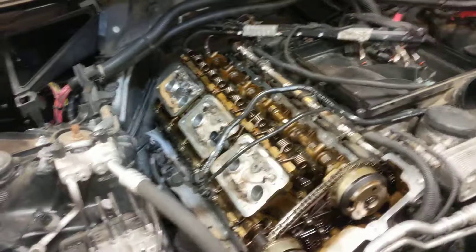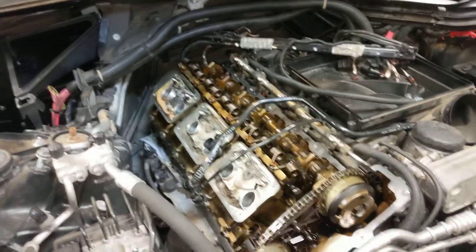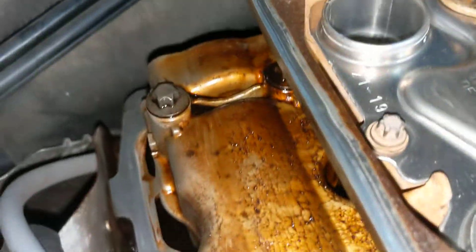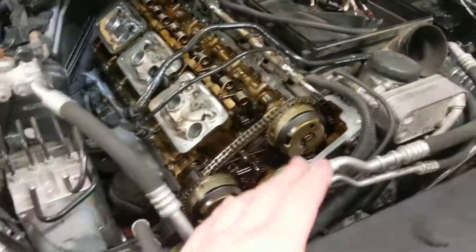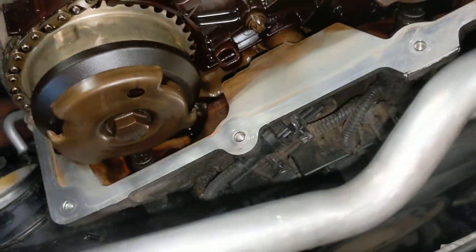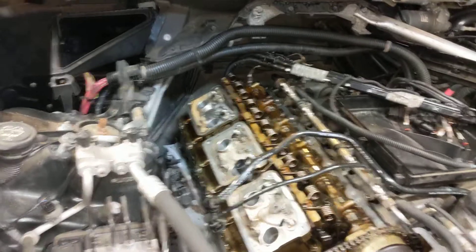It wasn't brittle or anything, unlike the oil pan gasket, which was absolutely atrocious and just broke apart. It wasn't leaking out of the front, but before I cleaned it, that back corner was pretty oily — that's where it was leaking and dripping down the motor. It may not show up front, even though the front is pretty wet. I think these are the Vanos solenoids and the cam sensor seals, but it's more so on the back end that it's leaking.